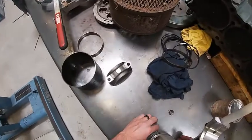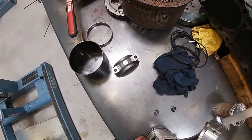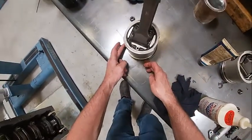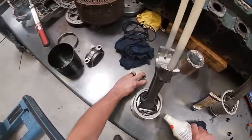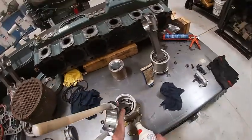We're going to orient our rings. We're going to go not on our thrust faces there. Then we're going to come over here and put that one at 180 degrees from it. And we're going to put our oil control ring at 90 degrees from that. We want to lube the heck out of it — put lots and lots of oil on there. You can't have too much.